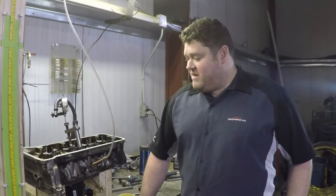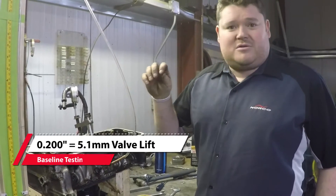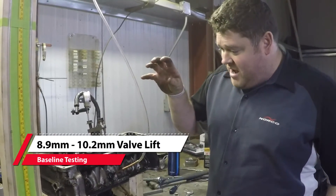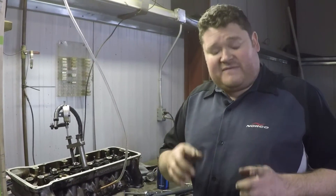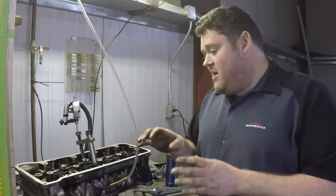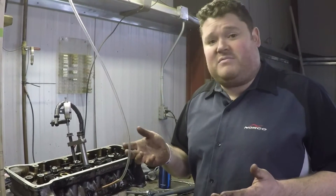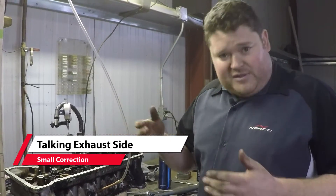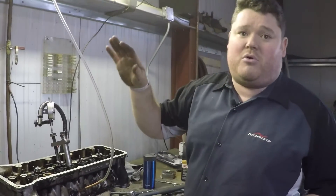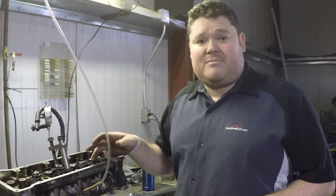After our initial testing we found some interesting things. On the intake side this head stalls out at 200 thou lift, whereas most heads normally start to stall out around the 350 to 400 range. At 200 thou lift it is not flowing any better, and in fact once you hit the 350 thou lift it actually starts to flow worse and would make less power in this configuration. Now this is dirty valves and a dirty chamber — the way any high mileage motor would be. On the exhaust side however, there is not as much flow as expected, but it falls off predictably and evenly across the board. The intake side as of right now is where this thing has serious serious flow problems. Now we are going to clean the valves, clean the combustion chamber, and see how it flows after we do that.